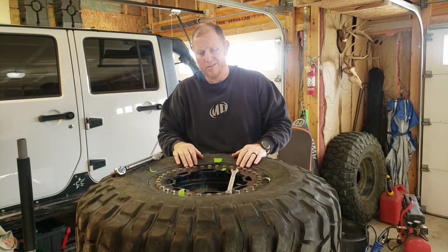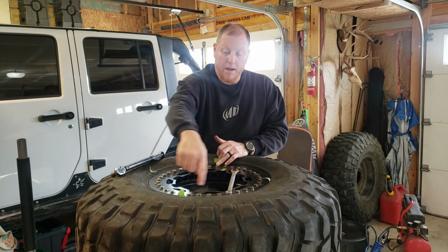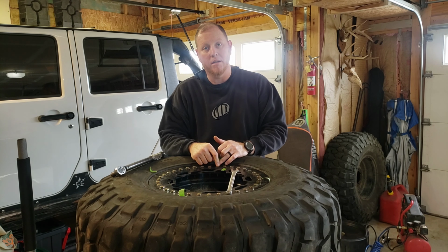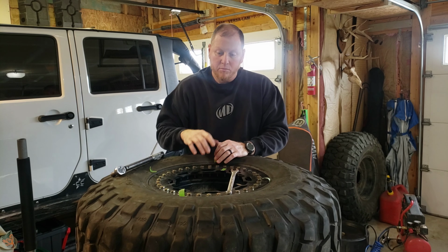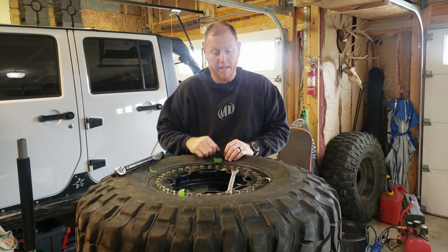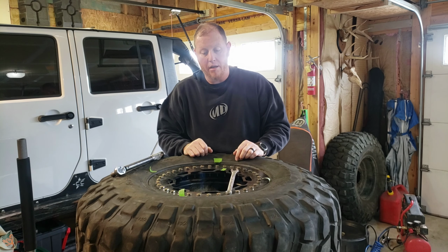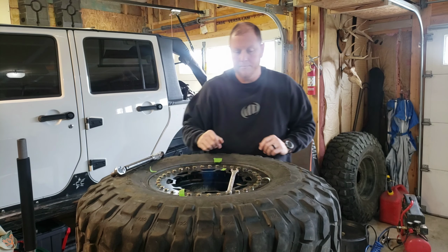I've already got all that done, so what I'm going to do this time is I'm just going to start here. I'm going to go around to 25 foot-pounds, and then we'll see how that acts, and I might have to go down to 30. We'll go around again until they're all down and they hit 30 pounds, and we'll put some air back in it.